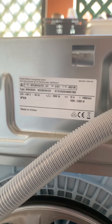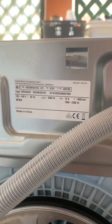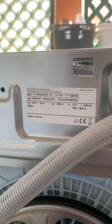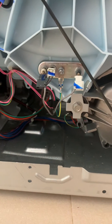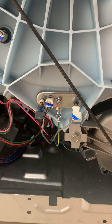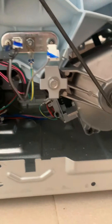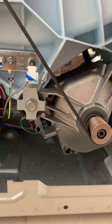Here is a quick video about a Bosch Series 6 washer dryer that's constantly tripping the RCD as soon as we plug it in. I suspected the heating element located at the bottom of the drum was faulty, but I unplugged it and the same problem still happened. I then unplugged the motor and the same thing still happened.